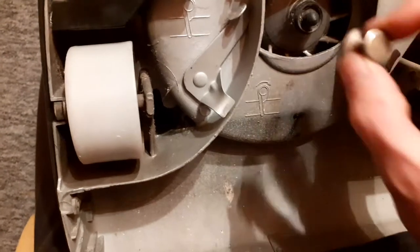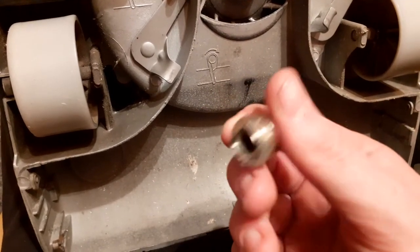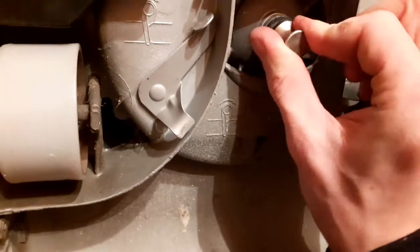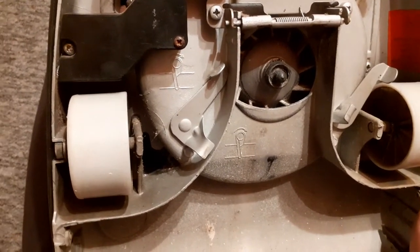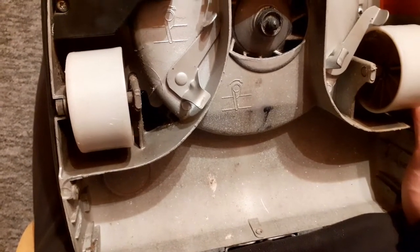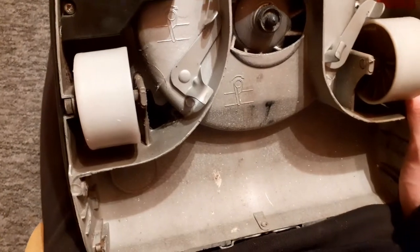It's more disappointing under here because there's no brush roll, the base plate's missing, and there's not even a belt pulley. There was one but it came off when I touched it — it's a two-part belt pulley, metal top piece and plastic bottom, and it's worn away. Strangely enough, the Hoover Senior 652 range of spare parts fit this machine. How is that for a coincidence? Because this isn't a Hoover Senior — this is a Summit vacuum cleaner with absolutely nothing to do with the Hoover Seniors.